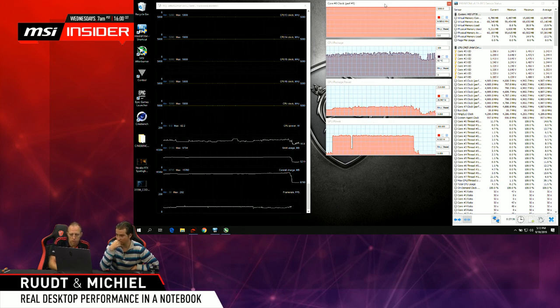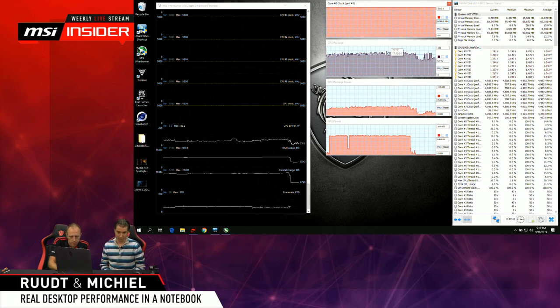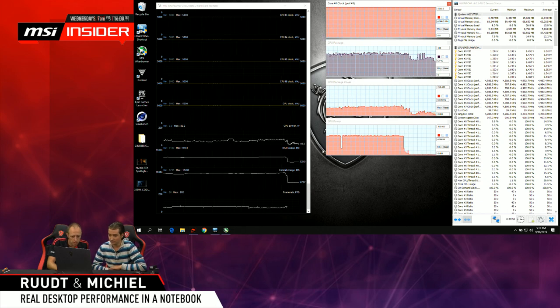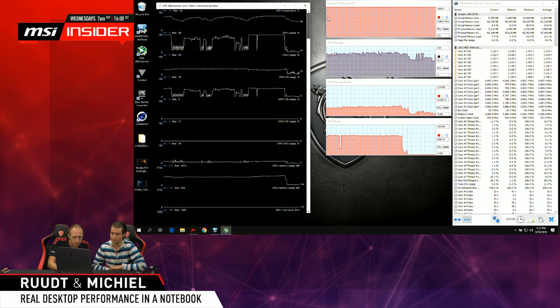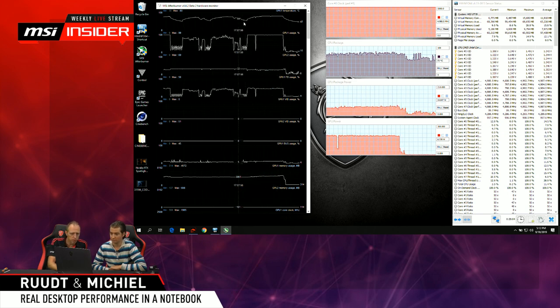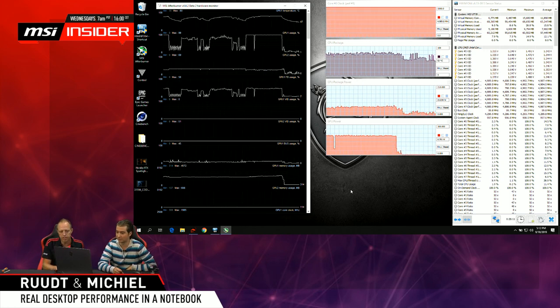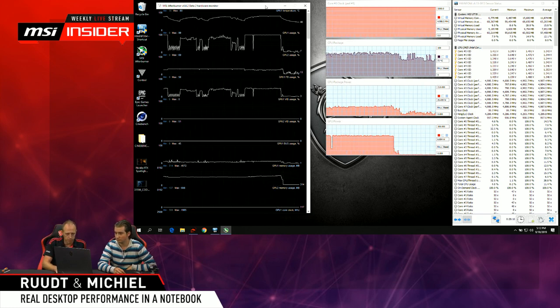More enemies, more smoke. Now 5 gigahertz all through what we can see here. And package temperature for CPU about 70, 80. CPU power is about 60-65, GPU power is about 190-200, so that's basically what we saw. Yeah. So that's quite good. GPU temperature is probably on the top somewhere, and that's also around 80-ish. Sometimes it drops. I think when it's around 80, it also revs up the fans, so it will keep it quite steady. It tries to keep the GPU always below 84. Otherwise, you'll lose some of the turbo boost.